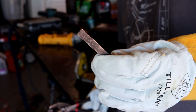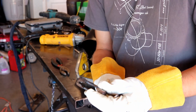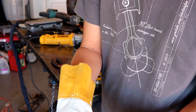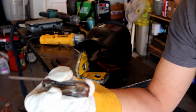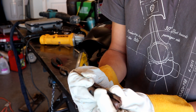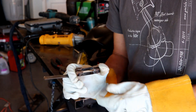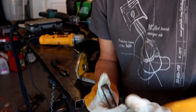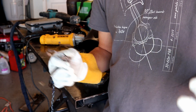I had some leftover stock from my giveaways, so I've sectioned the bracket and put it back together — just tack-welded it in place right now. I went and put it under the car to see how much clearance is around it, and I've got plenty of room where I can kind of reinforce the sides and double up on the material. I know you guys are probably thinking I'm contradicting myself because this isn't going to look factory. Last time I was at O'Reilly's I was trying to find just a bracket like this in a longer iteration and they were of no help. So this is the solution for today — I'm happy with it, it's going to work for me.